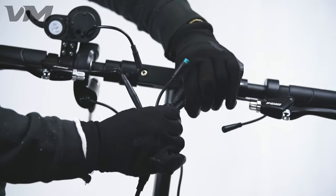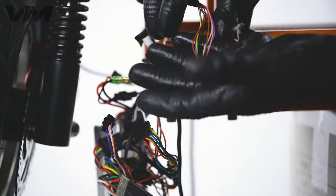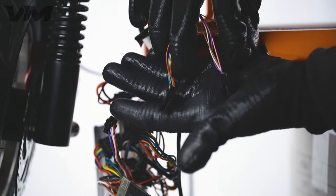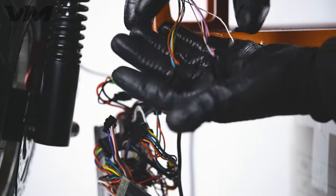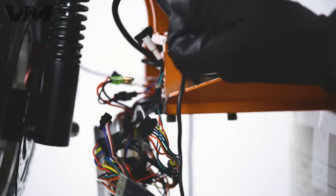With the power off, we can now disconnect the main connector line from the scooter. We start by pulling the connector pins from each other at the top of the stem. We then move to the lower cavity to look for three cable connectors: a four pin with purple, gray, pink, and brown lines going in; a six pin with red, orange, black, green, blue, and yellow lines; and a two pin with a white line going in.